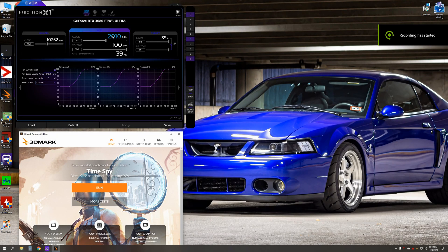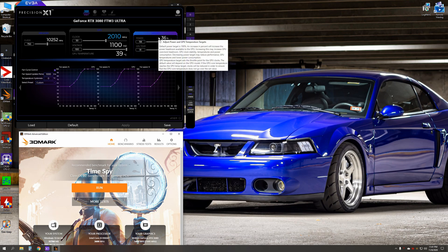So we just finished the default settings. I'm now going to show you a few quick tweaks you can do. I just went ahead and maxed out the power and GPU temp settings. You may notice that 118 is higher than yours goes to — you're able to change that by downloading a new BIOS. This is the EVGA 450 watt aftermarket BIOS that I loaded to the card. It's really pretty easy, maybe two minutes of work. And just for the sake of this test, we're going to max out the voltage.